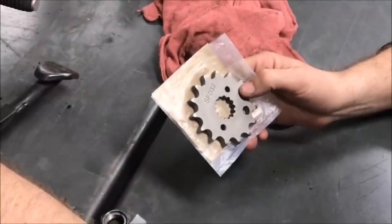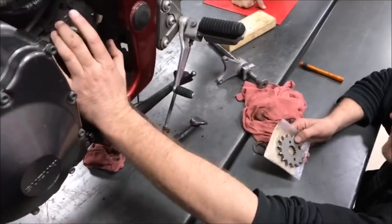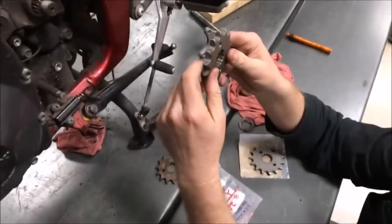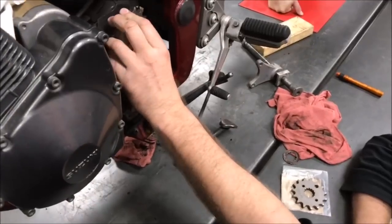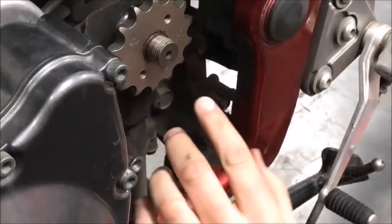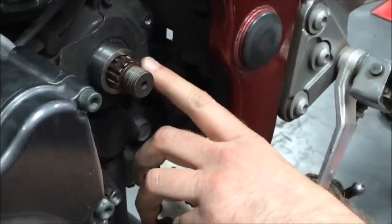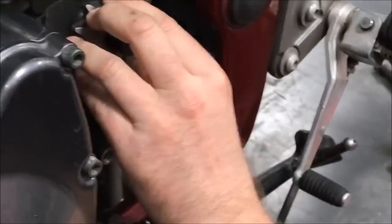The JT sprocket - that fit is pretty impressive, the wider spline. What's the whole point here? Inspect your parts - you can get brand new parts that aren't going to fit well. And do we just put this on dry? No. Anytime you're dealing with splines, the recommended lubricant is moly - like we talked about with shaft drives, we put moly on spline surfaces. We'll check our manual, but we're going to moly that up.